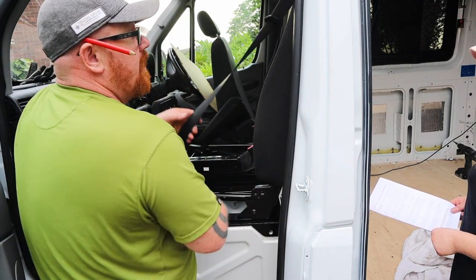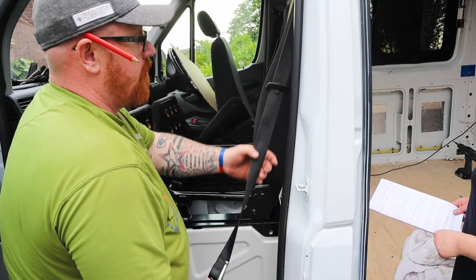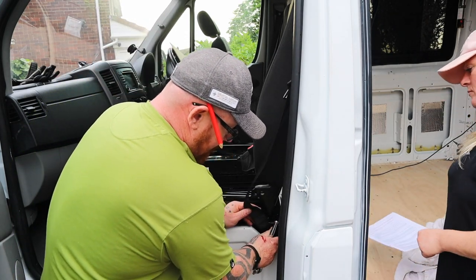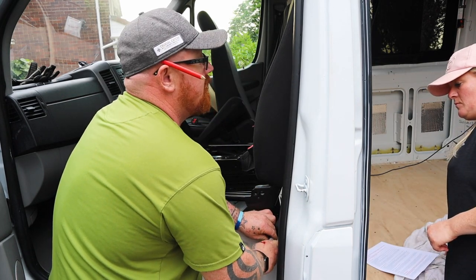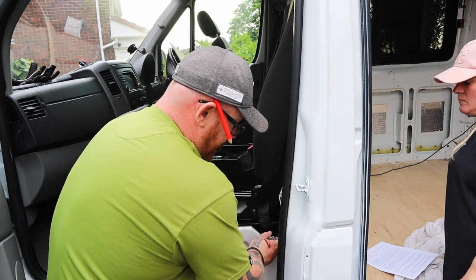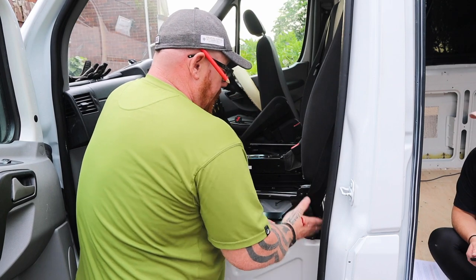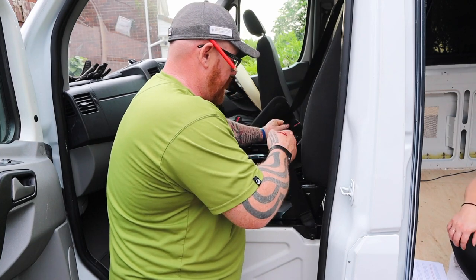Take your seat belt fixing and lower it down to the back of the seat on that bolt there, and then when you move your seat around the actual seat belt doesn't move with the seat. So now the seat belt isn't attached to the seat — it's attached to the base. It's still secure, it's still safe, it still goes across, and it still buckles to the actual seat belt. So it's fine.